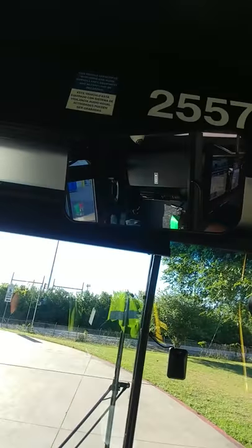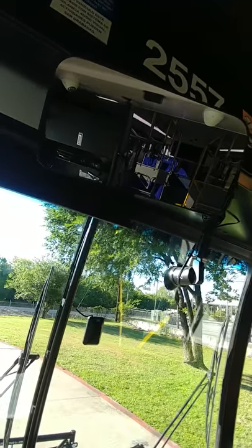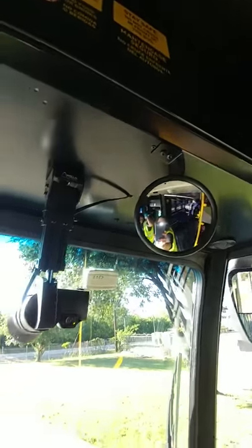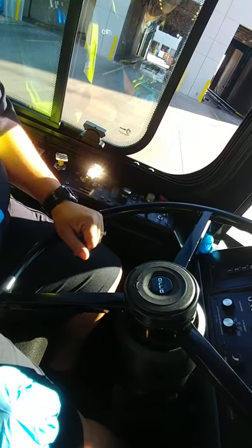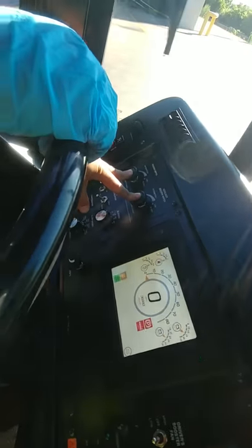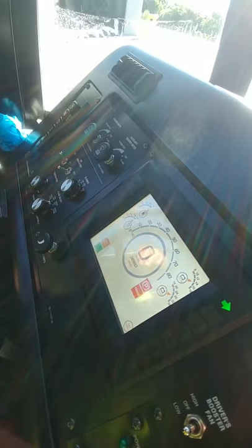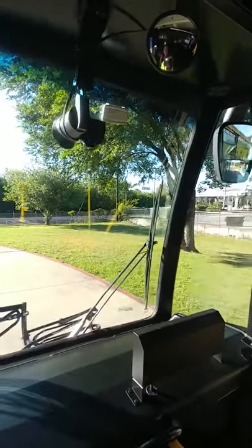I have a passenger mirror. My rear view mirror — making sure I can see my rear door and all the way to the back of the bus and everything to my right. I have my ADA mirror — making sure I can see the ADA seats directly behind me. Checking my hazards. On my dash, making sure my wipers actually work, that they have proper fluid in them, and the fluid is actually hitting the windshield. Checking the windshield again for any cracks or damages — because of the glare, you can see cracks on the inside you may not have seen outside.